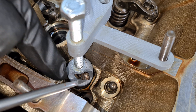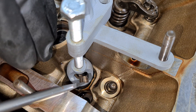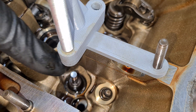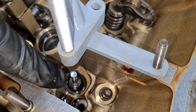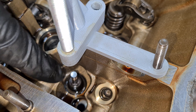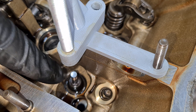The way to do it is to start with the valve all the way up and then carefully compress the spring so that it doesn't push the valve all the way down. At this point the valve stem seal should grab onto the valve and prevent it from falling down. If you have worn valve stem seals they probably won't hold the valve up, but if you've just replaced them, the friction between the seal and the valve stem should be enough to prevent the valve from falling.